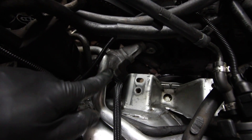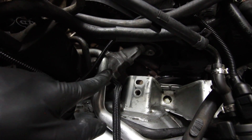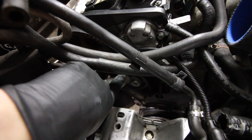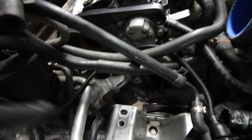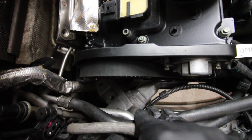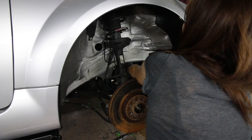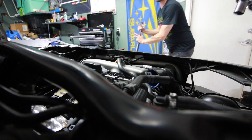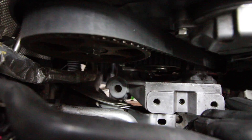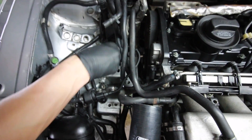I am back. This is the hardest part — I'm really glad to have Aaron here to help because getting this engine mount back up in here requires him raising and lowering the engine while I try to fish it in. There's a part that sticks out that has to clear past these pulleys, and it's not easy because the actual space you have to work with is not much — it's like a stupid puzzle. All three bolts are actually on that dumb motor mount. So it's the home stretch.